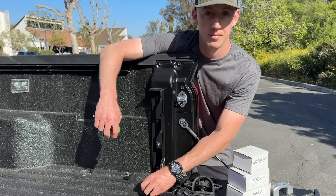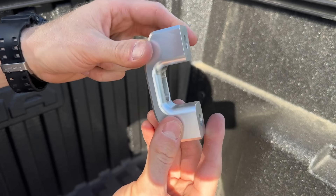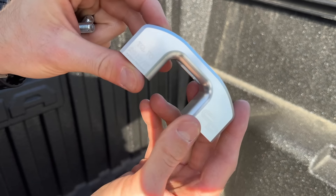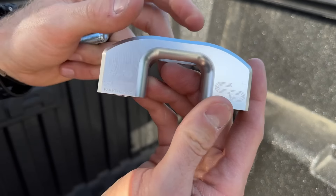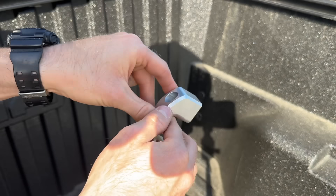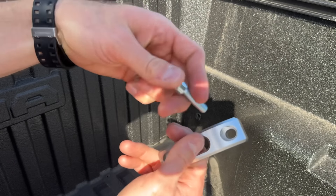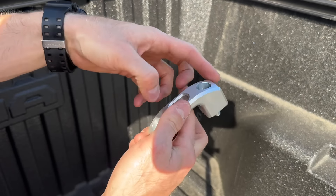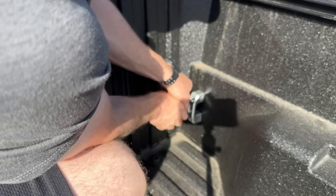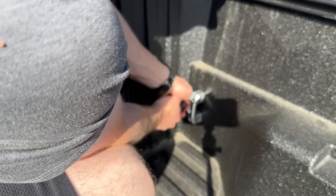Here's our tie-down and here's the hardware it came with. For each tie-down you can either face it with the engraving not showing on one side, or show the engraving on this side — it shows what to torque it down to, which is 20 foot-pounds, and has the Charboni Designs logo right there. I'm going to show mine off facing this way. Feed the hardware through first, line it up with the holes, hand-tighten it for now, and torque it to 20 foot-pounds at home.